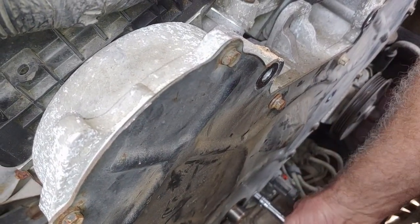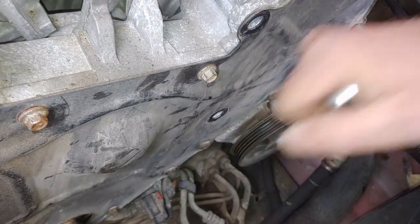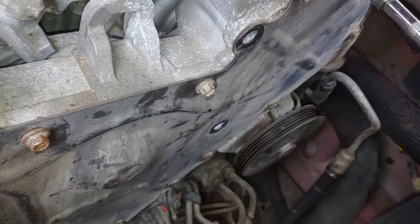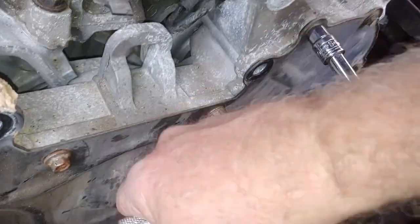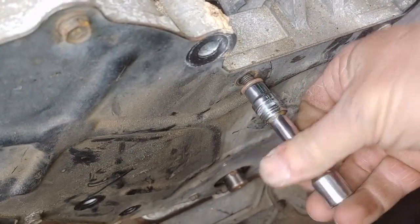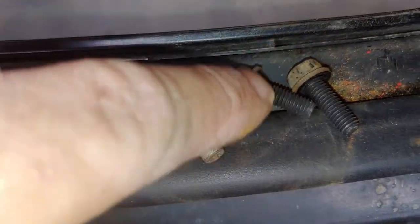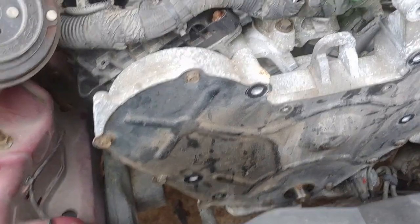And there's two belts. That'd be interesting to see. Oh, they're tight on that aluminum. Don't take much to lose one, but kind of cinched up. Alright, I'm going to go ahead and get these bolts out, and when I'm done, I'll pull the cover off with you. I'm going to show you this. The top two bolts, although the head is a 10 millimeter, the bolt thread itself is larger than the rest of these that retain the cover. Just something to think about when you're putting it back together.